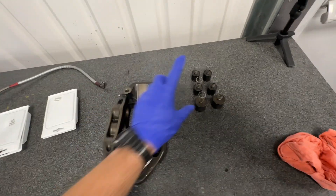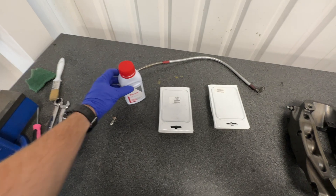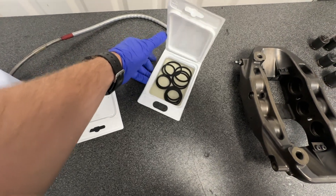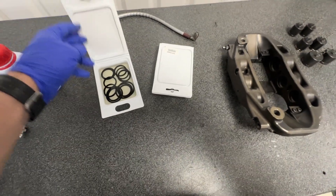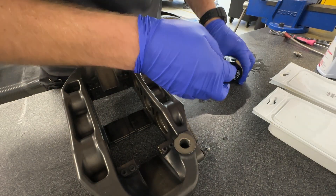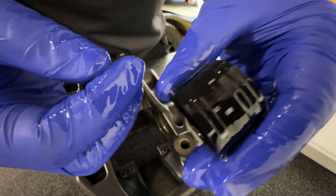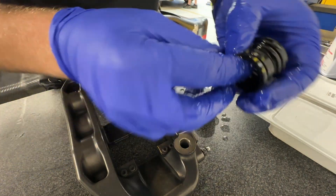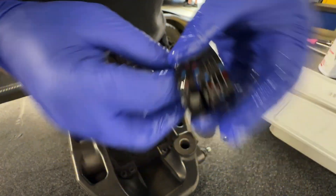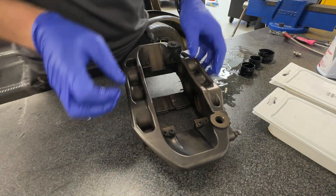Here we are, now ready for the rebuild. We've got the caliper, all the pistons, new seals, and they are in the seal conditioning fluid — you've got to condition the seals. I've left them for just over 24 hours soaking in the fluid. They are now ready to go and slip into the caliper. They are color coded: the medium sized ones have a white dash, the small ones are white and yellow, and the big ones are blue and red. So now I've got them organized into their three different sizes to stick them in the caliper.